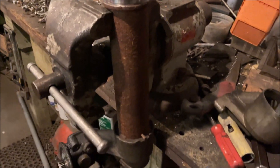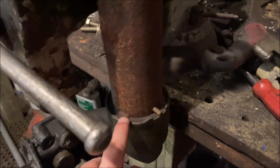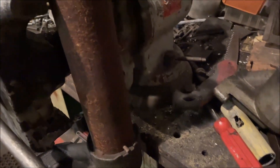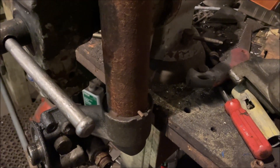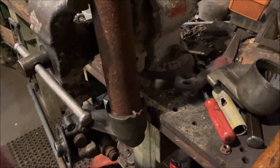I've got it flipped back over on the vice. We're going to be catching the lip on the vice for the side that is off the cooler, and now hitting this side. One thing to note — you might want to take some paint or a marker and put lines so that when you're putting it back together you know exactly where to put it. Once you have one side tapped in, the other side should be perfectly even with the surface. So yeah, I'm going to set the phone down and show you me tapping the other side off.